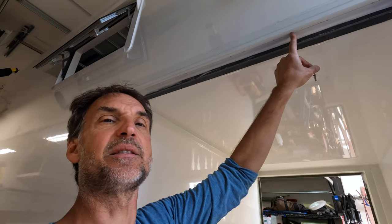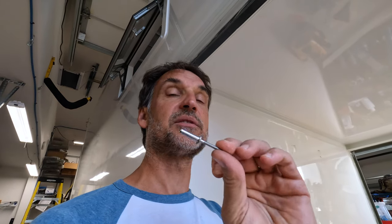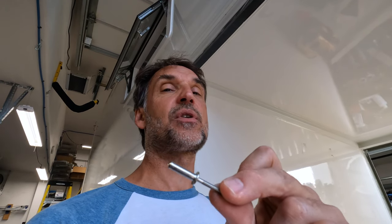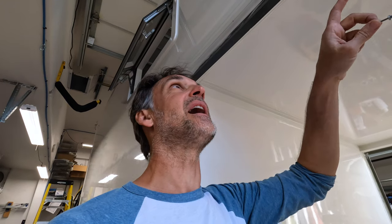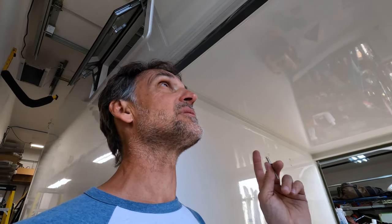I want to make sure no water or air gets inside the panels. These sealed rivets are also stainless steel — very strong and harder to pull through. They're a half-inch grip because I have about three-eighths of an inch to get through my fiberglass reinforcement on the other side of the protrusion, plus adhesive sealant on both sides. Yes, it's a little more work — I have to pump the rivet gun three or four times per rivet — but I want to make sure I'm grabbing properly. I'll drill all holes, check placement as I go, put down a bead of sealant, then pop the rivets starting from the middle and working toward each end.